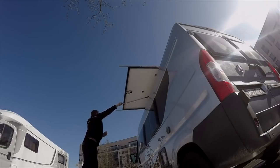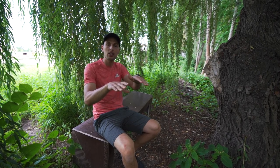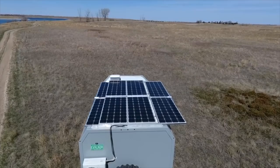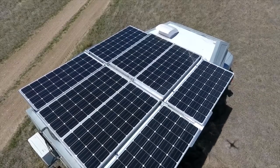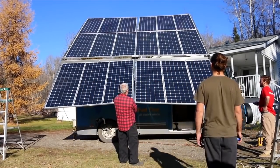A lot of suggestions came with: why don't you have a second row of solar panels that slide out on a slider and then extend, essentially doubling your solar potential. This is what I see as a problem. It's expensive. You essentially buy two sets of solar panels that you just have passively most of the time when you're driving, when you charge as well. If I ever was supposed to do it, I would want that to tilt anyways, because when you have a low sun or winter months and you're collecting 400 watts and you double it to 800, with just one row tilting it, you get the same amount of power, maybe more. So this is the whole thing, that if I ever have it, I want to gain maximum solar power from that too.